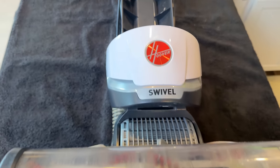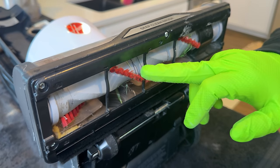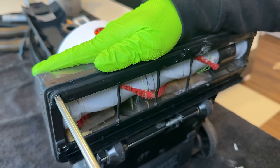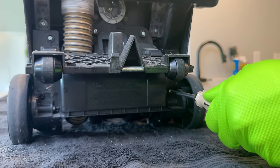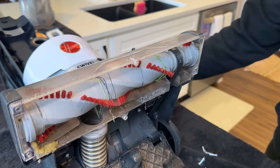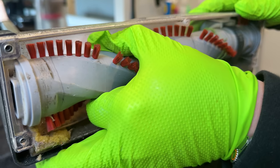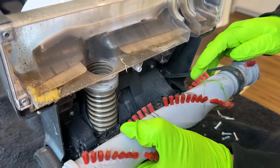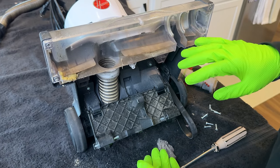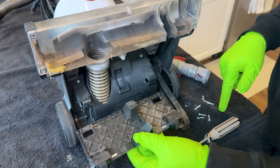I got all the easily removable parts out. Now we're going to remove the brush roll. You can see there's some fuzz and things connected to it. There are usually just a few screws on the bottom that hold the tray in place. This bottom tray just pops out completely — you can see there's quite a bit of dust in there as well. This here is the belt. You just slide this side out and the brush roll comes completely off. Every vacuum cleaner's configuration is going to be a little different — for instance, this bottom wheel tray comes out, so we can clean that up as well.